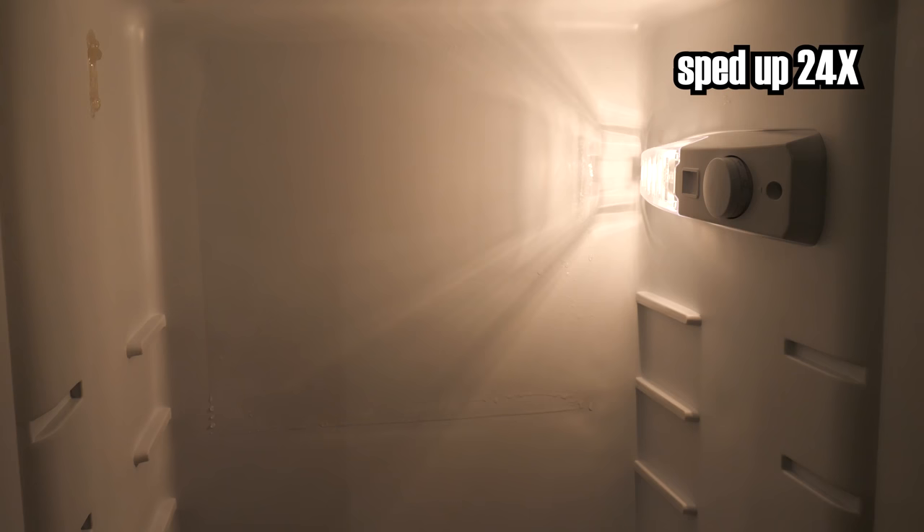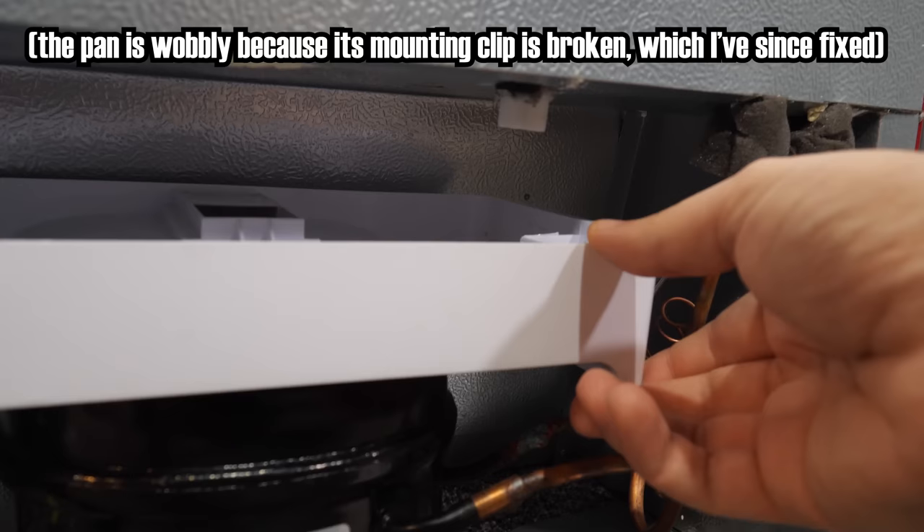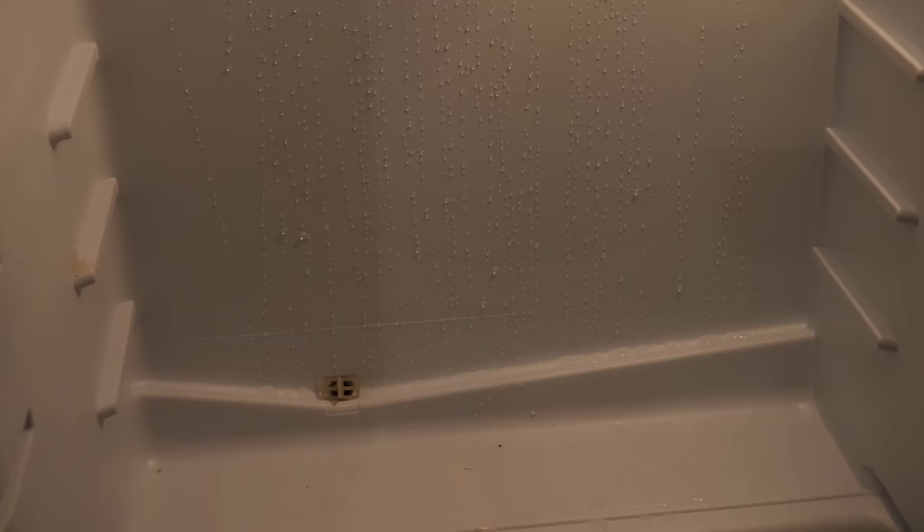Even cleverer is that the evaporator is self-defrosting. Since this is a vertical surface inside the only mildly cold fridge compartment, once the thermostat satisfies and the compressor shuts off, that ice buildup will have time to melt into water and simply fall down. It collects in this little sloped drain here, and gets dumped into an adorable little pan that the compressor wears as a hat. After it's been running for a while, the compressor gets fairly hot, and that warmth will help encourage the water in the pan to evaporate. And just like that, you've made a self-defrosting fridge — no heaters or timers required. Pretty cool, right?